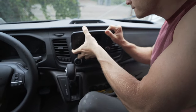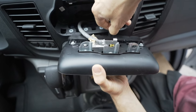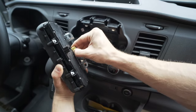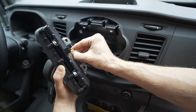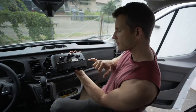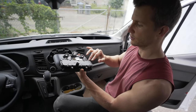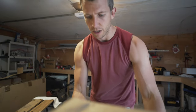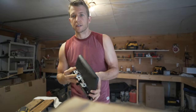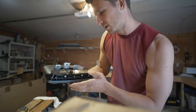Just lift up and out and we've got two cables here. Pull the little clip — that goes into the audio controls. It's a tricky little pin on the side there. Now I just need to pop these screws off and mount the other audio controls with the other unit. I need to put these two pieces together, so I'll grab the screws off of this.